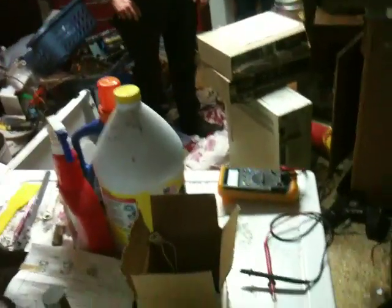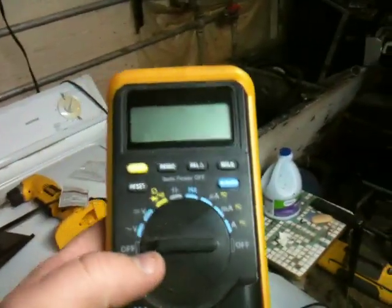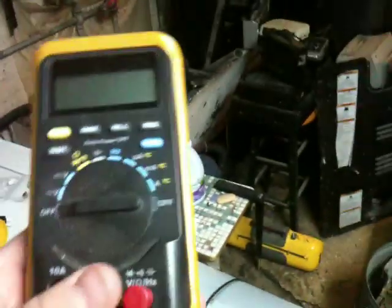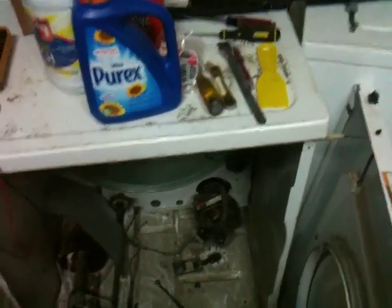Now the duct doesn't seem to have been blocked, and the impeller seems to be moving plenty of air and not slipping on its drive shaft. So all we can guess is that our wonderful cheap Whirlpool scratch and dent dryer, which has survived at least one basement flood, and maybe that hastened the demise of the thermal sensor, finally gave up after so many years. An ohmmeter test, after finding the part referenced in the schematic, confirmed what I thought, that the little thermal protector, which is a one-shot device, blow it and it's time to replace it with a new one, there it is, had finally succumbed to years of use and just failed.